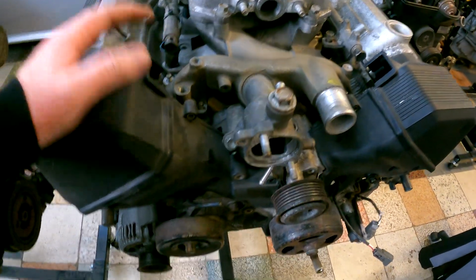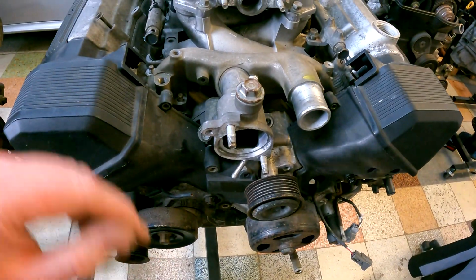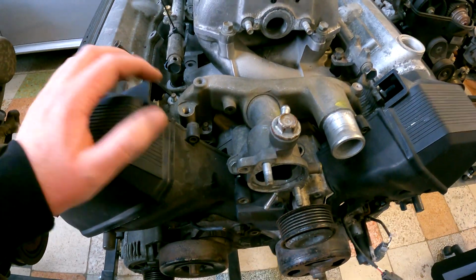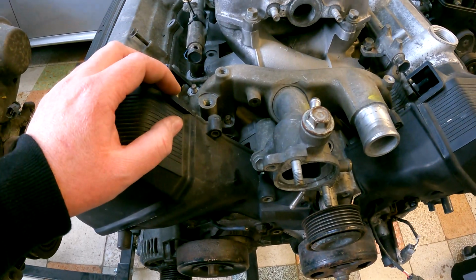By all means, you can just remove the alternator, the oil pressure and the aircon plug off of those, and that's all that we need. You can just cut them off and send them off with sort of 2 or 3 inches of wire, just enough so we can deepin them. Obviously it's got new terminals, new wire, everything is going in.